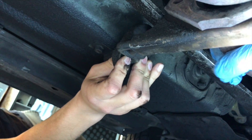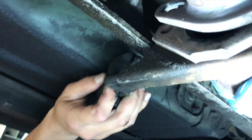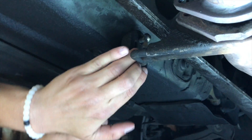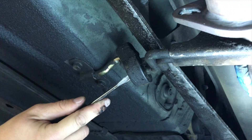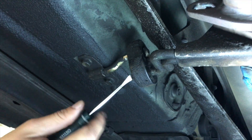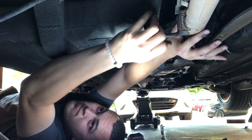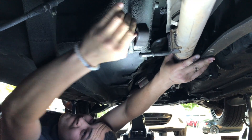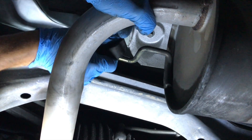You can see that we removed the hangers starting from the front going back. My recommendation is if you can't get a particular hanger off, move on to the next one, and by the end you'll have all of them off — you have to, to remove the old exhaust. We tried using a flathead screwdriver; it didn't work out very well. So we just kept pulling and tugging, and it broke loose. What you can do — and what I did the day before — is spray down the hangers with WD-40 in the actual insert part where the metal meets the rubber.